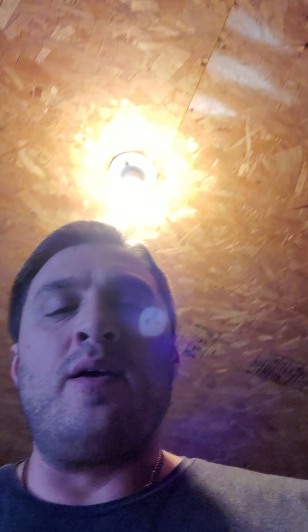Things that I had to do was I had to shorten the drive shaft — it was two and a half inches too long. And then I also had to raise up the muffler. So that thing right there I had to shorten two and a half inches, and then I raised the muffler up about four inches so that it could come off of the engine, the exhaust flange right there, and just come straight out the back.